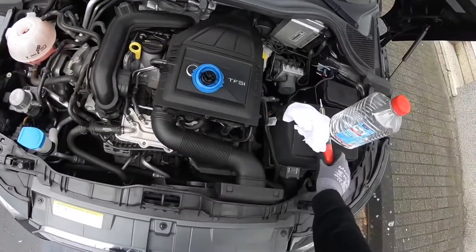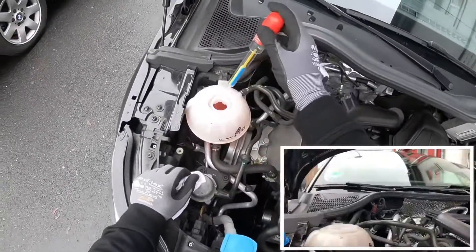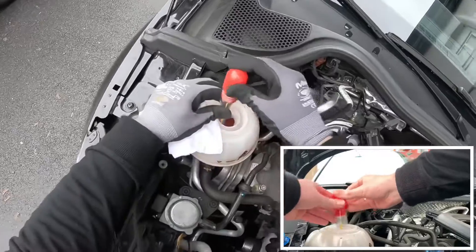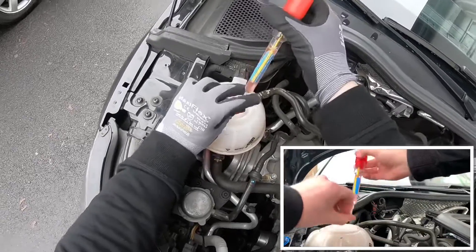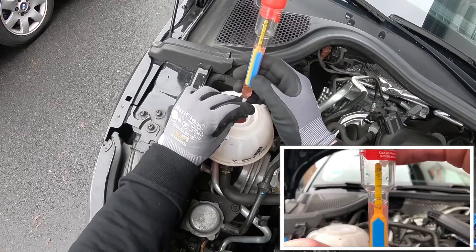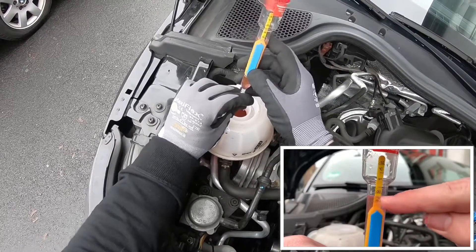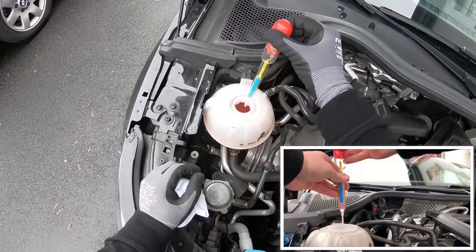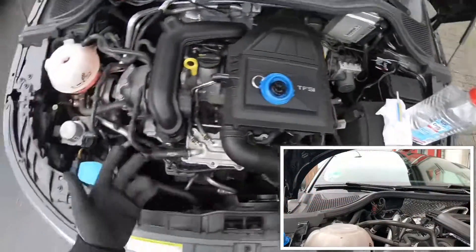If you have a hot summer or at the start of summer, you can top up a little bit with distilled water. But first, let's check the antifreeze level. For this, dip a little bit of engine coolant liquid into the checking device, and then you can read on the scale what minimum temperature your engine coolant will tolerate before it freezes.